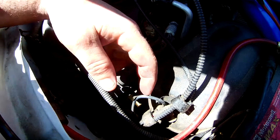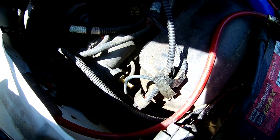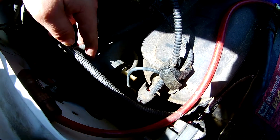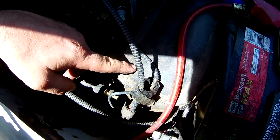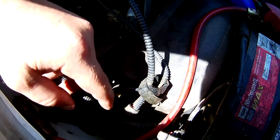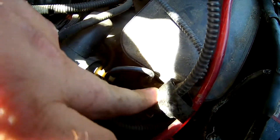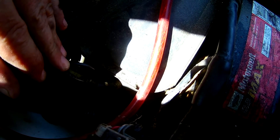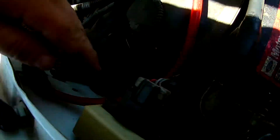So the next thing to isolate here — I'm just figuring it out as I go. This is a diesel truck, so if you had a gas car it would probably pull manifold vacuum from the intake. But because this is a diesel and these things don't really generate any vacuum, this is the vacuum pump, and this is a vacuum storage container next to it. This thing actually draws or creates a vacuum here, and from there it splits off. This red wire provides vacuum to this tank, and then this solenoid draws vacuum from that tank. One side splits off into the AC, this black wire, and the other red side goes into the actual solenoid.